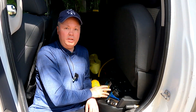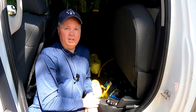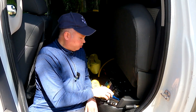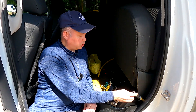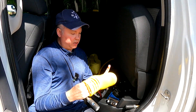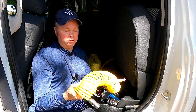Overall I've been pretty happy with the ARB twin compressor and the way I installed it. It's down here in this cubby and even with the seat down it gets plenty of airflow. Now what I don't like is the way I've installed the power switch — here on the side I have a tendency to bump it whenever I'm reaching into the vehicle, so I need to change that. I also have hoses routed to both sides of the vehicle with quick couplers, which allows a really short filler hose, but this filler hose is pretty small in diameter and it kinks easily. I've already got a small kink in it, so I'm going to replace this with a larger diameter rubber hose.